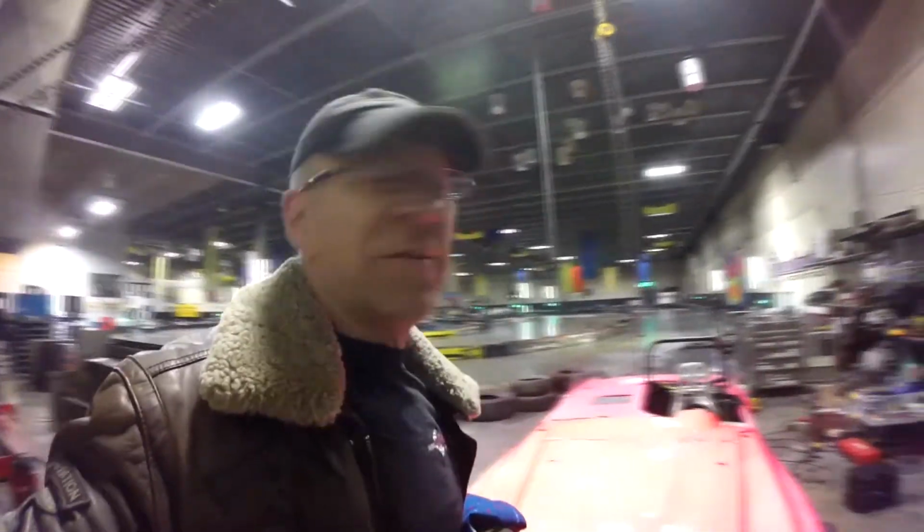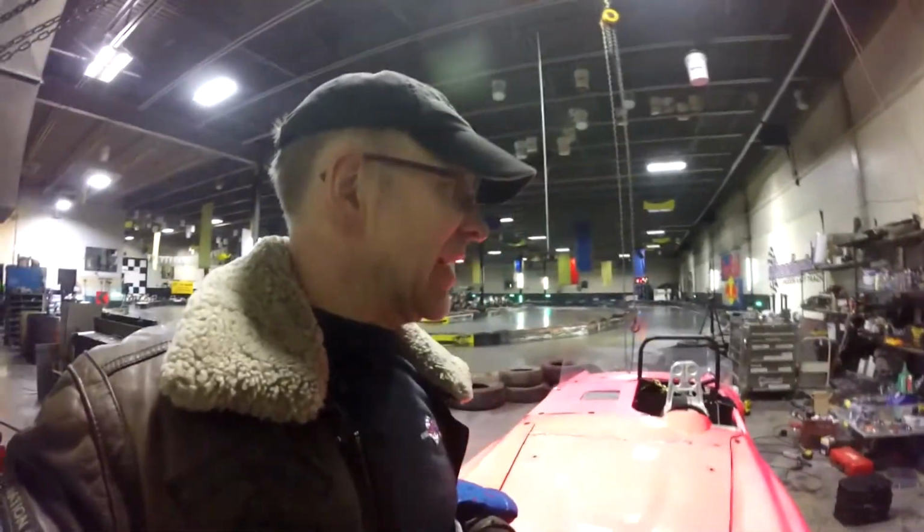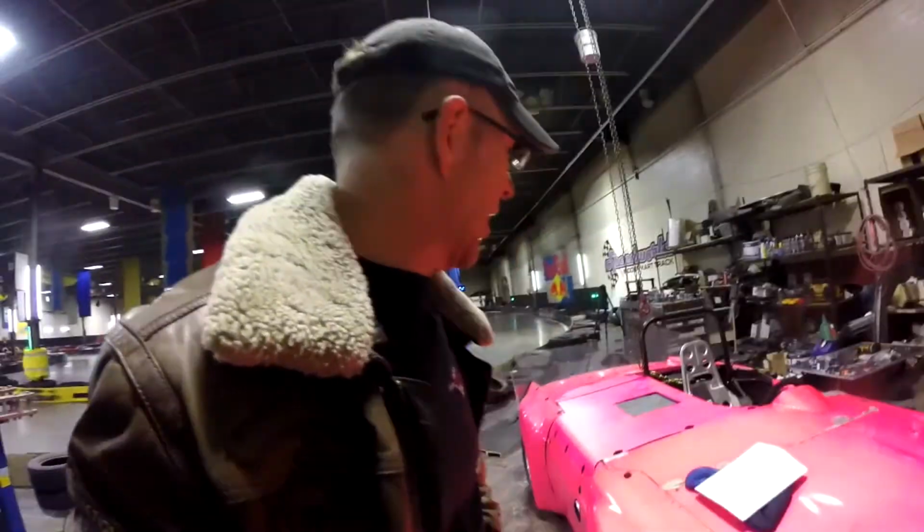Okay, so I tried to do a little bit of painting to fill in those panels that were just raw aluminum, but it's too cold. The primer went on really nice, and the base coat, like the white, also went on really good, but the pink, disaster, complete disaster. It did this weird wrinkle pattern on it. I don't know, it was just really odd. So it doesn't matter because the entire car was going to get repainted before Nationals anyways. I just wanted to cover it up for the events leading up to Nationals, like Spring Nationals and stuff.